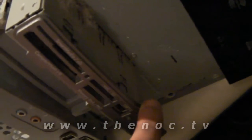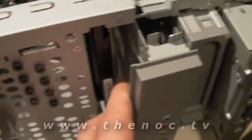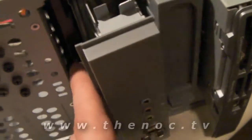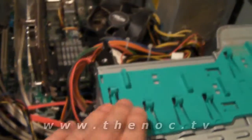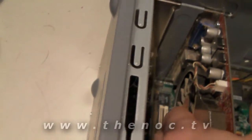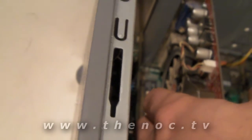Make sure you check around your memory card readers, CD drives, and hard drives. I've actually unscrewed this bracket so I can show you the hard drives — the dust will build up right under here, in that gap around them. If that happens, your hard drive overheats and will fail much sooner. Another thing to keep an eye on is your graphics card. As you can see, that's supposed to be a black fan, not brownish gray. So we need to clean that.